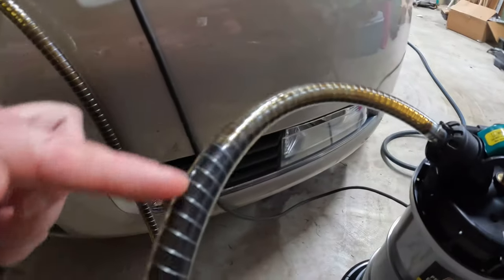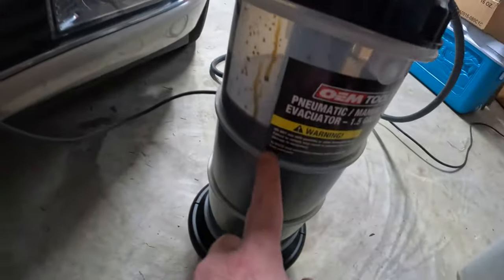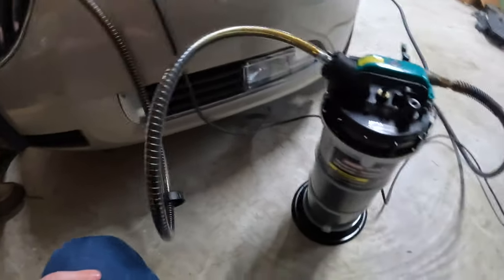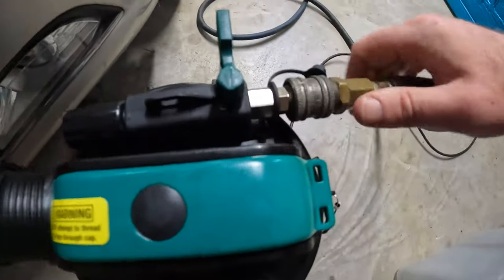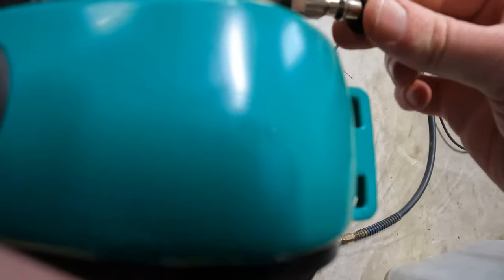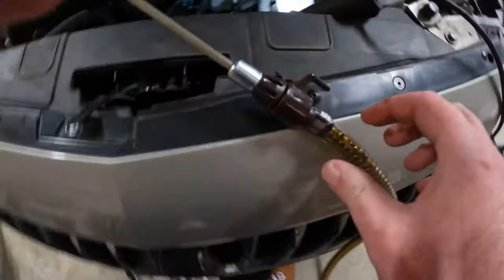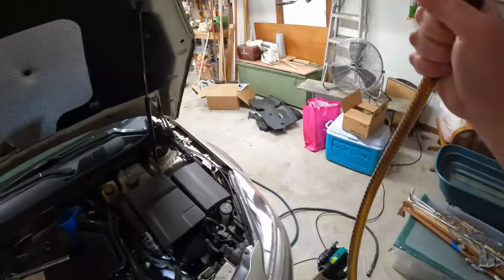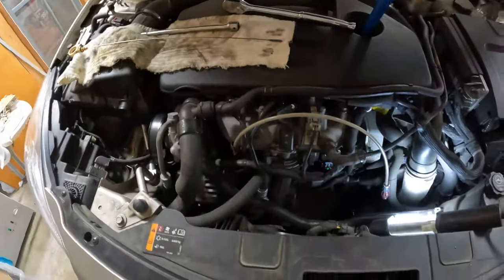I think it's just about done. I'm going to let it run for a minute or two more, then put the dipstick in and check it. Now that we're done, I'm going to disconnect this airline. Turn this to off. Put the cap back on, just in case. It's got a dry brake right here — take it apart. Then turn this hose up like this and let all the oil drain from down in here into there. What little bit's left will go back into the car.